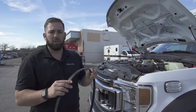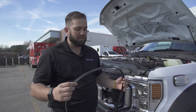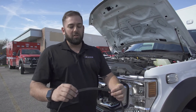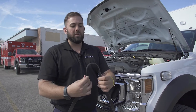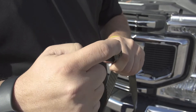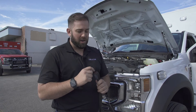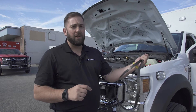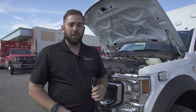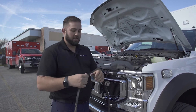While it's out, you can take your belt off and do a check to determine whether or not the belt is still good. Look for obvious fraying, cracking, or chafing. A good rule-of-thumb trick is to simply turn the belt inside out so the grooves are facing out — fold it over like that — and in a one-inch area, count the number of cracks. If you have 10 or more cracks in that one-inch space, the belt's bad — throw it out and put a new one on. Fewer than 10 cracks, you can reuse it, as long as the belt isn't dried or chafed in other areas.